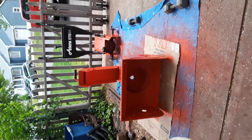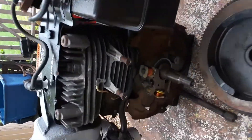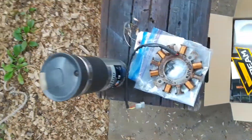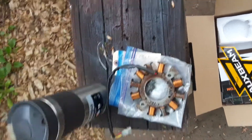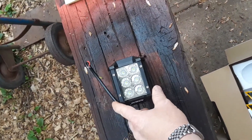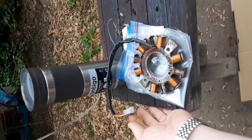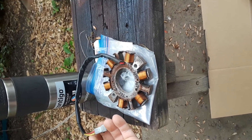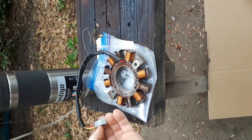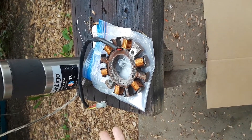I'm putting this engine back on this 1987 Ariens snow thrower, which only had a headlight. It would have only come with the basic alternator, but I happen to have had this AC/DC one laying around and I'm going to install it because it works with that three-magnet flywheel. Then I'll be able to hook up an LED — such as this aux beam 4-inch 18 watt LED — directly into the DC side, and I'll still have the whole 5 amps of AC unused.